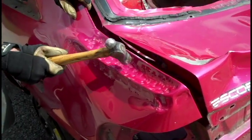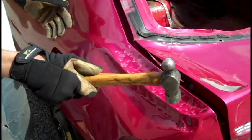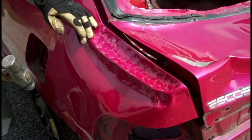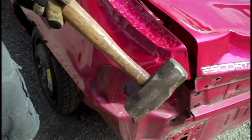What you want to do is take your hammer and get the initial part of the fender actually turning inside out. Do you use the square side or the round side? I use the square side to start with, but then I go to the round side after I've gotten kind of the rough form. For the bigger side panels we'll use something like a mini sledge, maybe four and a half pounds or so.